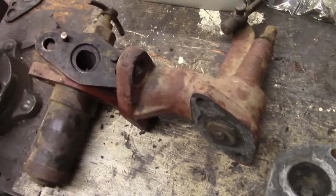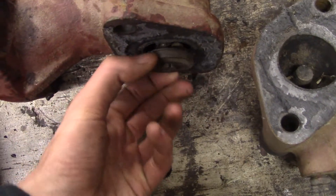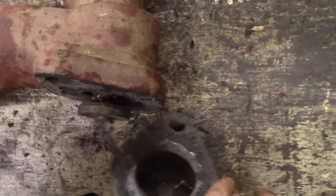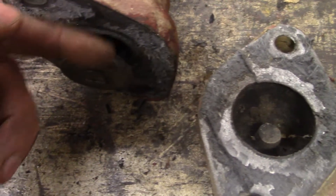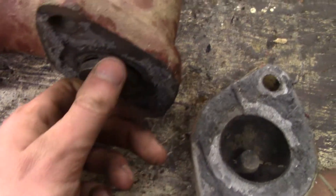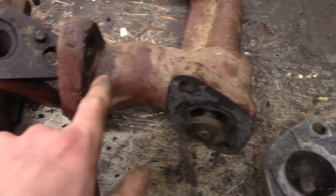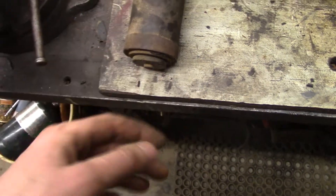Inside the mechanism there are two poppet valves basically. This is the air intake — here's the first valve and it's just free to open and close on its own. There's no spring or anything. In here, which mates up to it, there's a little peg sticking out — I imagine that's a travel stop so the valve can't go too far in. Air pressure coming in here pushes the valve against its seat and keeps it closed until the cam forces the valve open. Once the valve opens, the air travels through here, goes in and out this valve into the cylinder, and it'll turn the engine over.